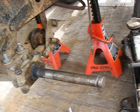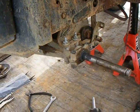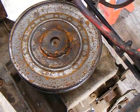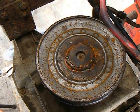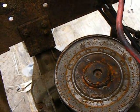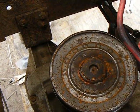Still got to connect up my pedal brake — those brakes seem to work real good. This is a Spicer. This is what I had in here and it got full of water. Still got to connect up my shifter; it's kind of floating up there. The belt keeper looks like it's in pretty good alignment, I hope. If it isn't, I'll bend it a little bit or cut it and readjust it. I'm going with that welded-up pulley from Tractor Supply — it runs a little deeper in the pulley, which is like putting on a smaller pulley, so I'm going to need a smaller belt. I'm getting ready to size that up now.